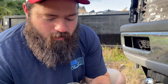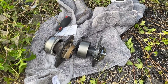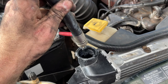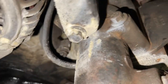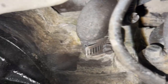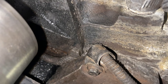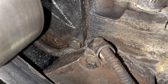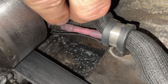We're going to pump the radiator cap off of it. I gotta get this thing back in because I gotta go pick up Caroline from the airport here in Florida. I done screwed up — you can see right there the wires are pinched on the new water pump, so I'm not getting a tach signal and it's not shifting. Here's my quick fix: a couple of butt connectors and we're good to go.